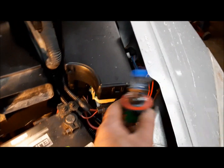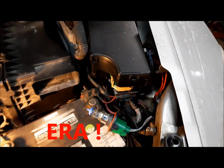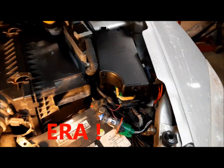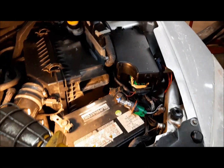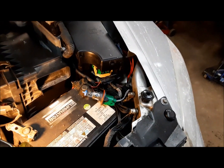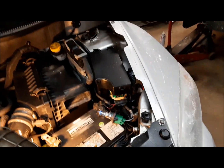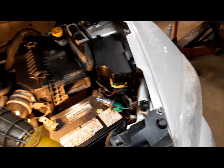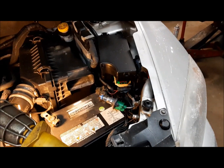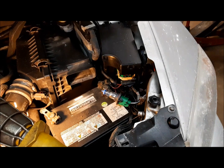Now it doesn't look burned out, and I'm crossing my fingers because Chryslers of this era do have issues with body modules deciding not to send current to bulbs here and there. I went through this on my dad's Dakota and I am a little worried, because usually if I've got a headlight or a brake light out, it pops up on the dash — hey, you've got a light out. And I got no such message.